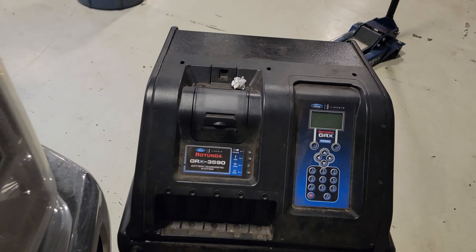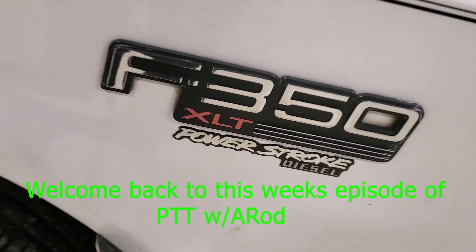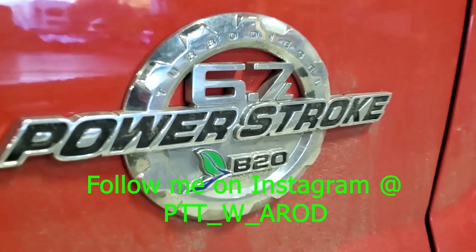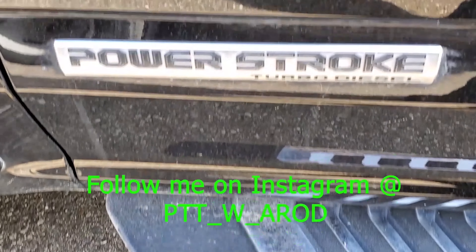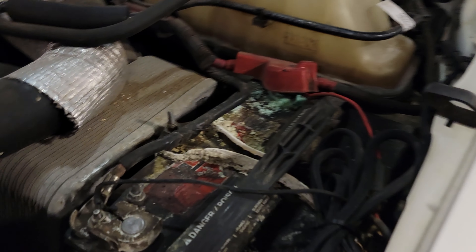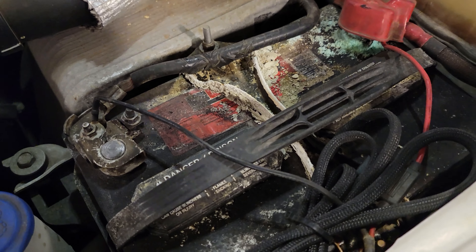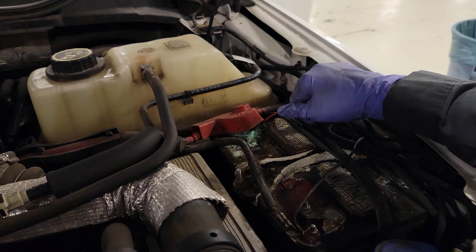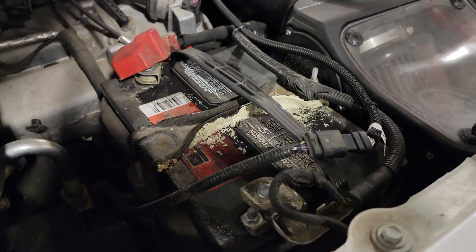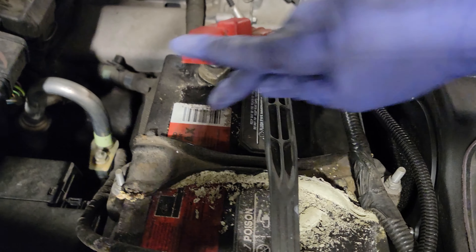Battery health, battery state of charge, and how you determine that — this is very important. I hope yours don't look like this. If you've seen me put batteries in, I always hit my terminals with some high-temp black spray paint — that seems to keep all of this nasty corrosion off the tops of the batteries. These ones look like they've been replaced, but I don't know how long they've been here.